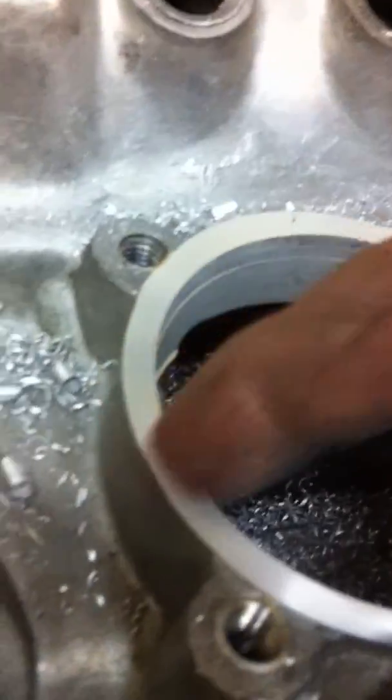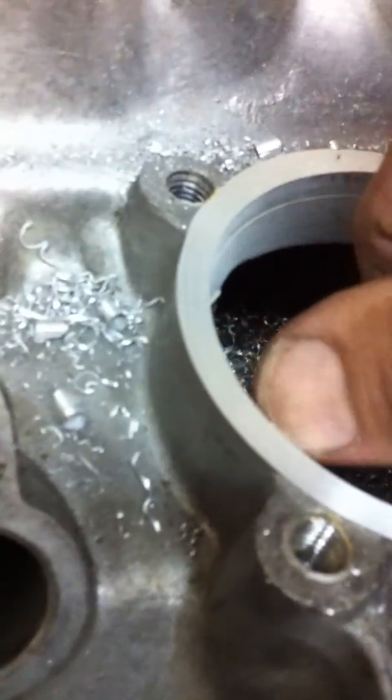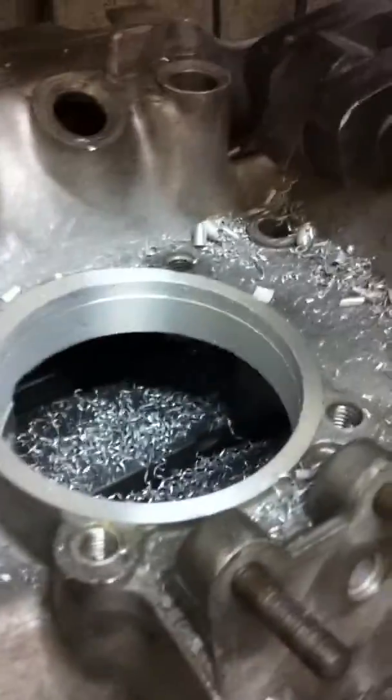We fly cut 20 thousandths off this part right here, so the pistons come up exactly the same height on both sides. And step cut the inside so the barrels fit, and you can put sealer around this upper edge that marks right here. Here's the upper edge that we want to put the sealer on — just a bead right along the edge here, and then that seals real nice and you'll have a perfect seal.